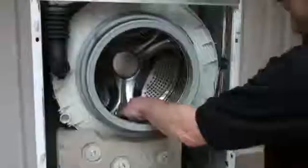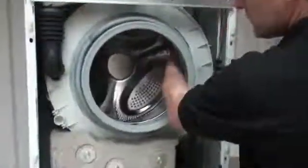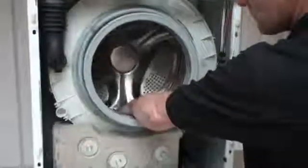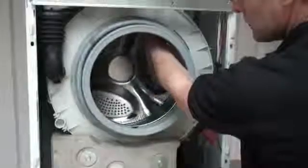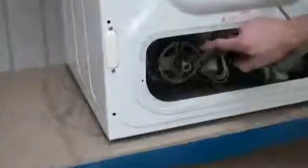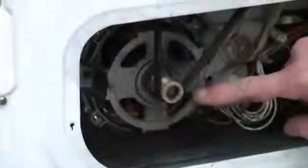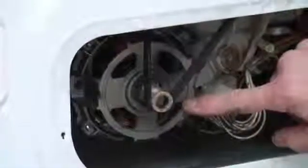Once the heater element has been turned on, the wash cycle will begin and your drum will turn backwards and forwards, agitating the clothes. Now if your machine fails to do this, then there's a problem, and it lies normally with either the belt or, worst case, the motor itself. Don't suspect the motor straight away. It's likely to be the carbon brushes if the belt is still intact.